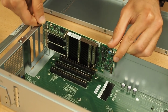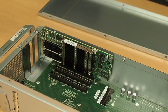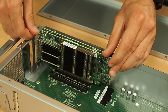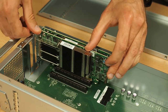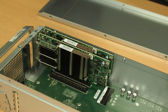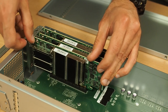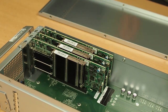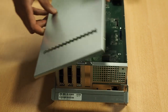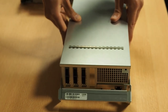Let's insert those cards now. It's interesting to see that in this new generation of chassis, we can accommodate scale-out: one to three cards per I/O module, making two to six cards for the whole chassis. These DPUs are ensuring high resiliency, so there is no problem accessing data. We have full access to data all the time, and they provide storage services without the help of any x86.